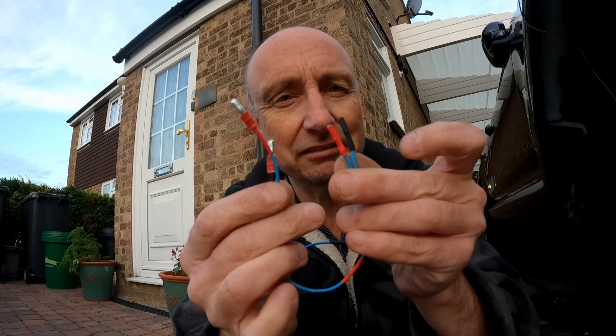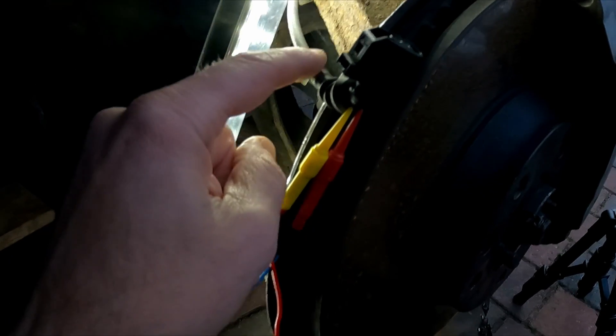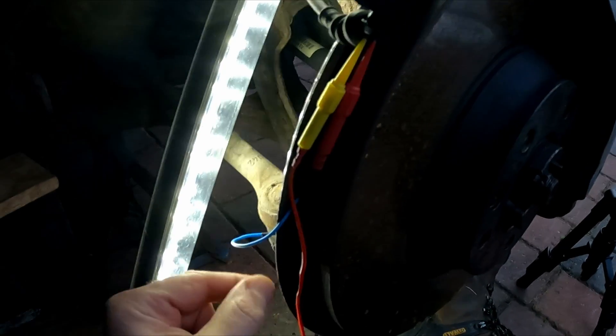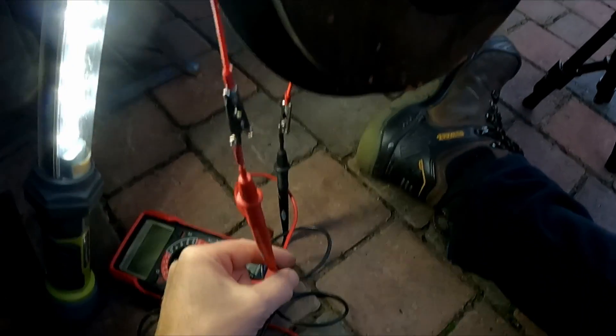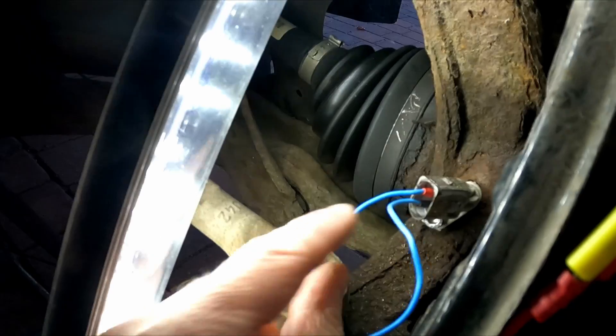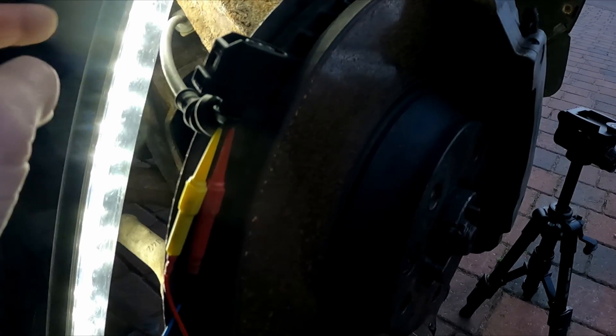After about 20 minutes in the garage I now have two test leads set up. The signal from the PSM module comes down into the yellow lead, back-probed, then goes into the meter, out of the other side of the meter, up to the sensor, and out the other side of the sensor back to the connector and off to earth. So I'm set up on milliamps and I'm going to turn the ignition on — in theory I should see 7mA. Fingers crossed.